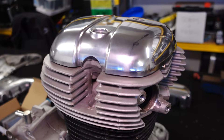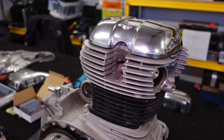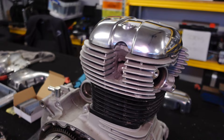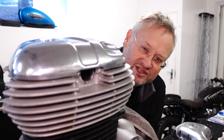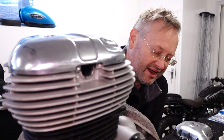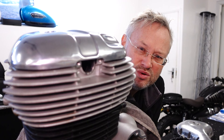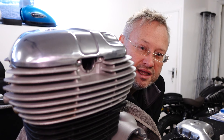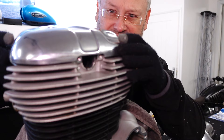There's the machine polished head cover. Now the top, which I didn't use rubbing down paper on, is not as good - which I expected. So it definitely still benefits from having the lines flattened down. Welcome back to day two. I spent about two or three hours on this yesterday - polishing it manually first, then using the older polishing compound and wheel. The wheel did do a good job - I'd call it a sort of 85% job, like many automated processes. It gives you a great shine and a great mirror finish.